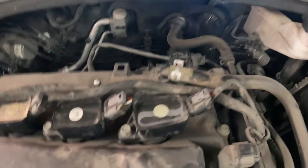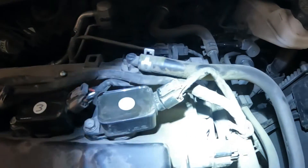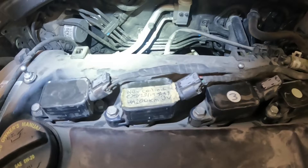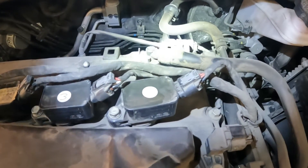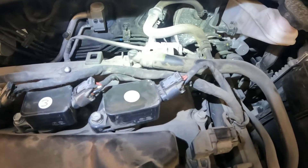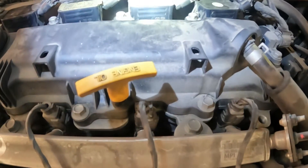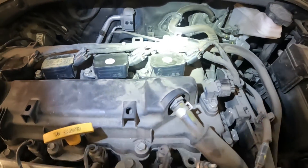Nothing on three. So we've got to find out if that's intentionally shut down or not, because it might be intentionally shut down. We will check to see if there are primary signals going to this coil. I'm going to be checking the primary voltage pattern on that coil. Each coil has a black wire in front, a red wire in the back, and the middle wire is the signal. We might use the middle wire to tell us if this thing is being intentionally shut down.